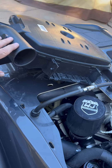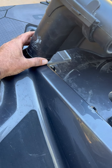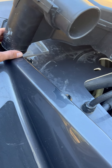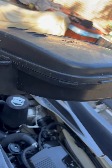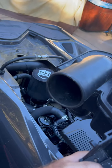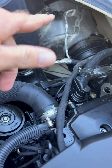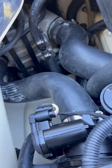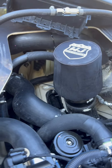This is kind of how the resonator sits inside the jet ski. This little outlet here was the main problem trying to get it out. I literally had to take it, turn it this way, then tilt the front end up to get it out. Once I moved the water box and the air box on this side, unhooked it, pushed them back out of the way, I was able to get it out.